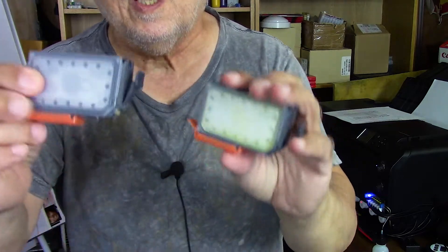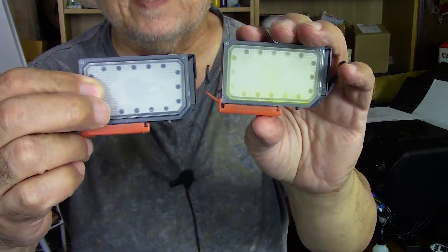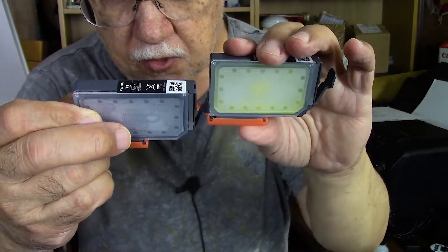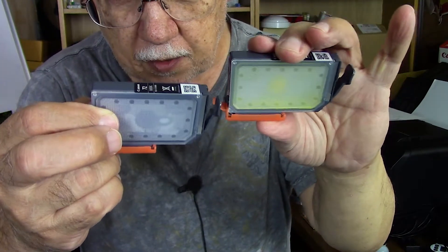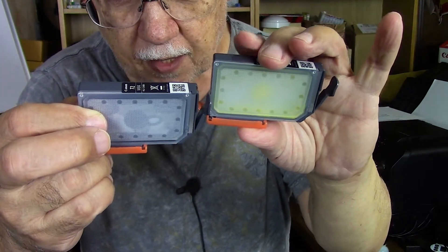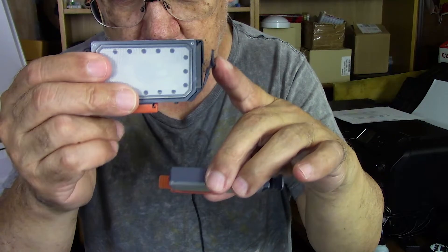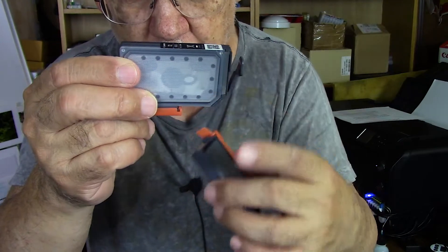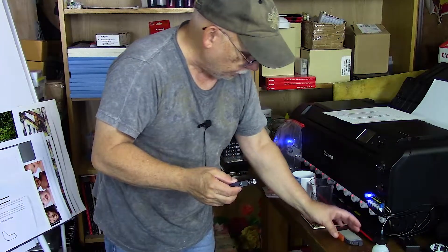Although I have clips installed on both of these cartridges, I want you to see right here — you see that diaphragm, it's all the way to the front. Now you can see it, and that circle in the middle is part of the diaphragm construction. Notice this other one — you don't see that diaphragm, meaning it's on the opposite wall, meaning that bag is collapsed. This one was allowed to sit for a period of time and the bag eventually expanded back out to full. I cannot refill this cartridge until I perform this operation.